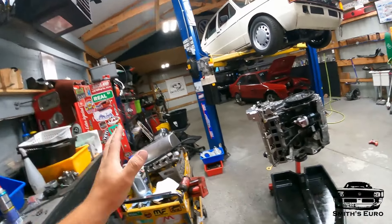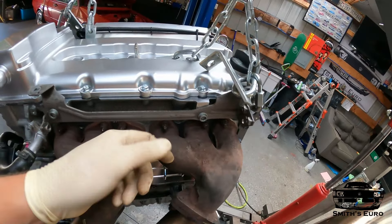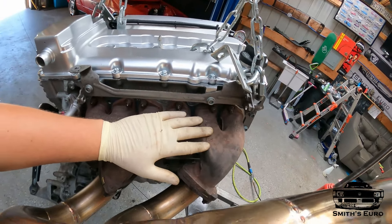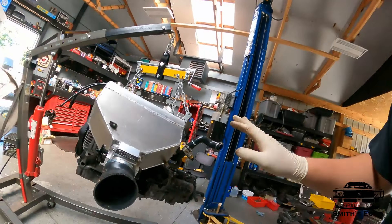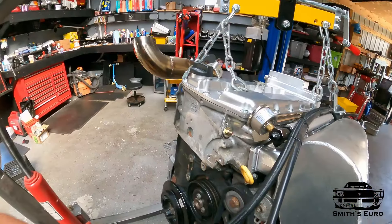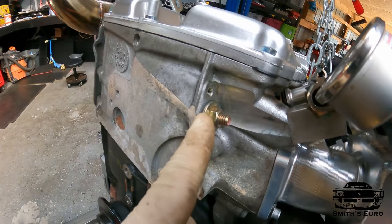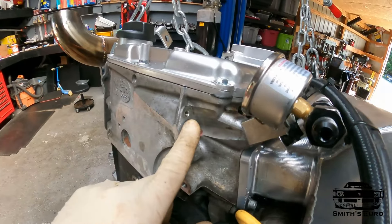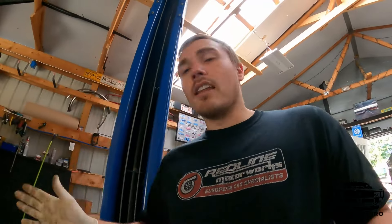Skipping ahead — here's the motor all together. These exhaust manifolds are technically different, they're a bit taller, but luckily they have the exact same placement. So if you have an older generation 3.6 and go up to the newer generation with the big ports, you still use your exhaust. I got all the mounts on, everything's ready to roll, it's even full of oil. One thing that's holding me up is this port here — I don't know what it goes to. I'm assuming it's coolant, but I just got one of those cheap expansion plugs. Hopefully it holds for now. I'm going to see if I have some actual freeze plugs later, but I just need to get this in the car — it needs to go racing this week.